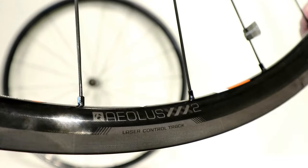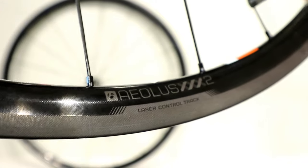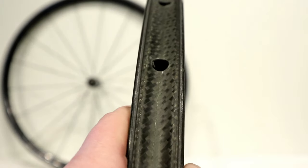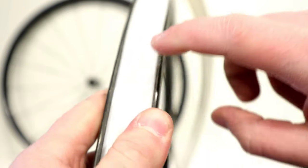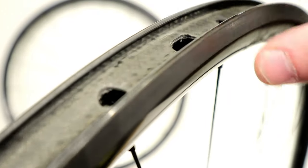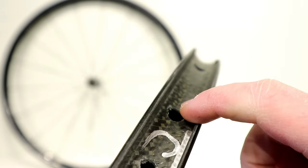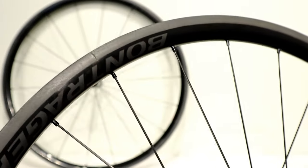There's so much actual texture there. That's because they use a laser to etch into the brake track, and that allows for much better braking performance. On the inside of the rim is a tubeless ready profile. It does that by installing these plastic strips that can actually clip into place, allowing for an interface between the tire and the plastic rather than the rim. They can have this nice shallow depth to the rim with a double wall setup. You can actually see the cutouts for the spoke nipples on every spoke, making for a super lightweight setup. Should you not want to run tubeless, you don't have to put that strip in — you can run just a normal rim strip. But with the strip, it makes for a really easy rim to set up tubeless.